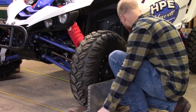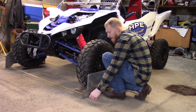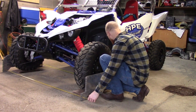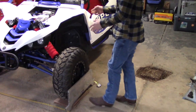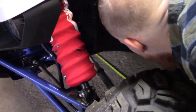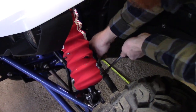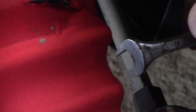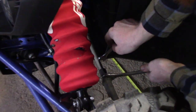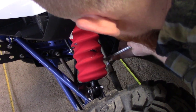That's 69 and 13/16 in the back and 69 and 15/16 in the front — so that's one-eighth. Ship it! With the stock ones it's real nice because you can just hold it — as long as the inner tie rod does not move, run this thing back in. Once you get to that point, I recommend taking another sharpie mark so you know where it's oriented and it doesn't move when you're tightening the jam nut back up.